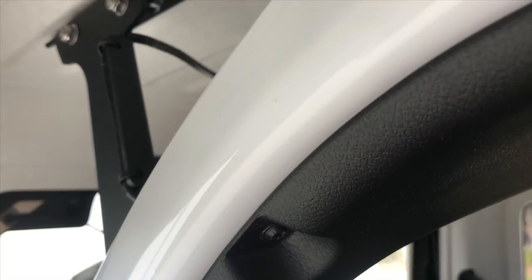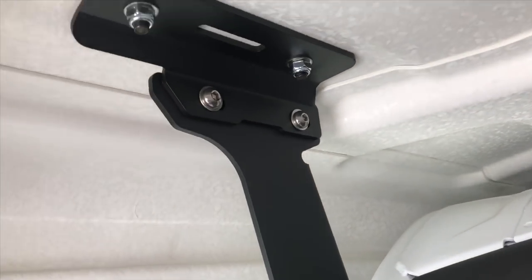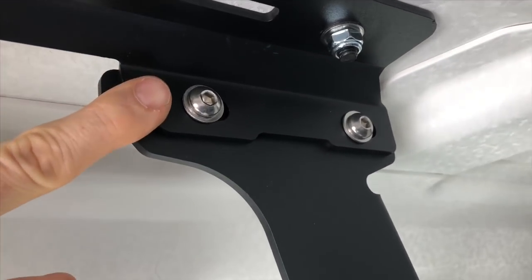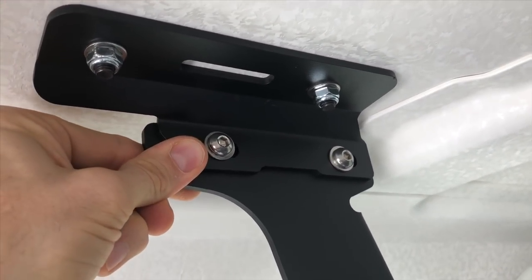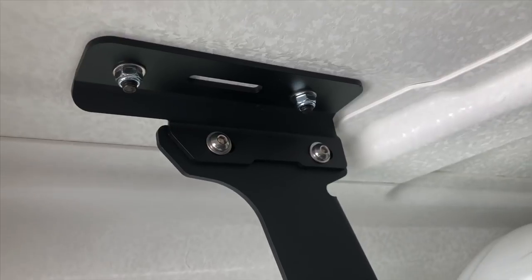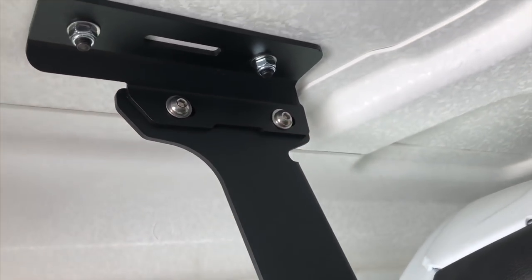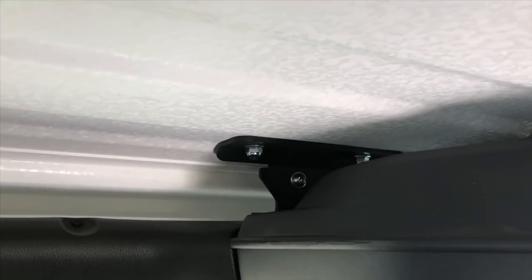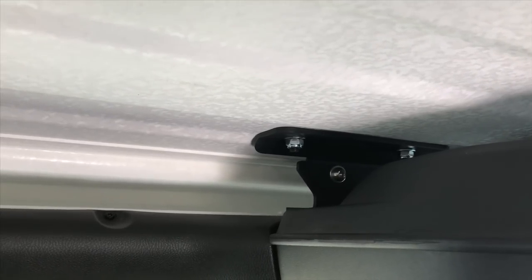That's one of the beauties of this solution — you have a fiberglass top which is pretty fragile, but none of the weight is on the top. Looking at the back here, what I really like are these two bolts. You can actually remove the lower and upper mounting points, so you can still take the hardtop off easily. You have a few more bolts to deal with, but it's still doable. The front brackets look a little tough to get to, but they're in two pieces so you don't have to take the whole rack apart.